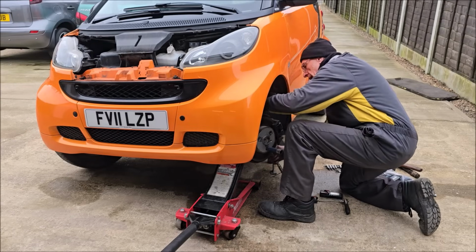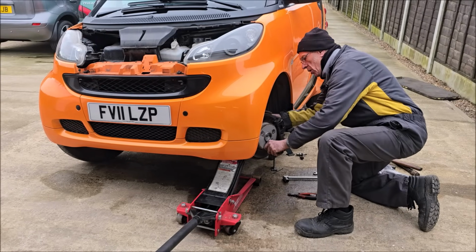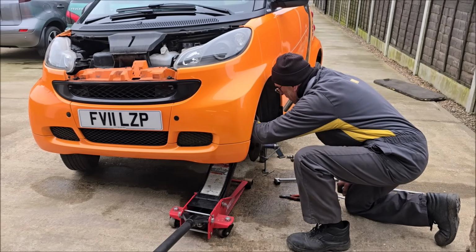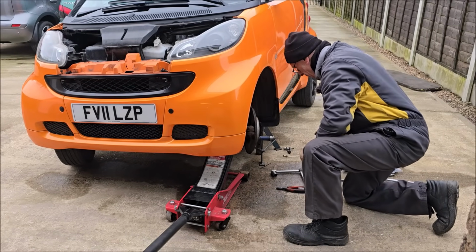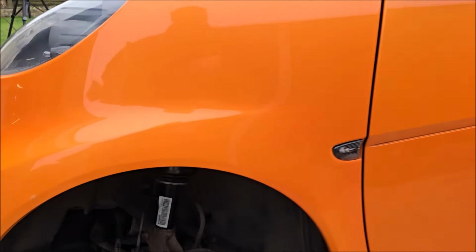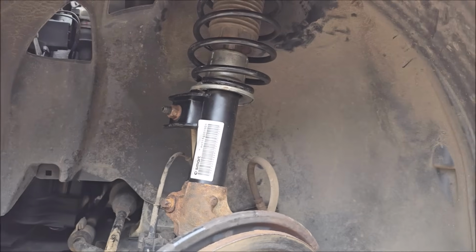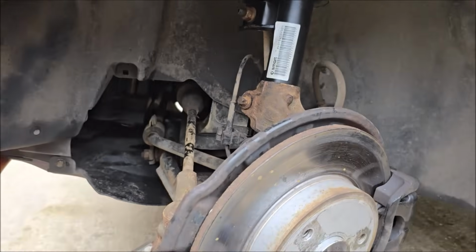Checking the caliper bolt, pinch bolt, bottom ball joint, track rod end. That's located, that's got a cable tie on it, top link, everything's tight. Now people will say, why aren't you cleaning all that off and Tectyl sealing it and wax oiling it today? Because it's bloody freezing and windy and horrible, and we're trying to get the job done.